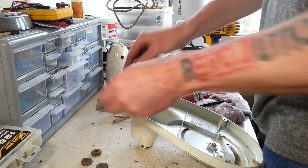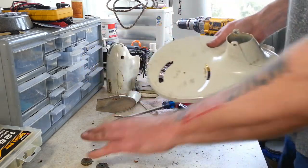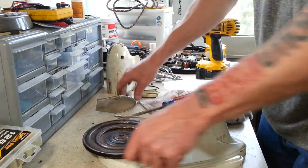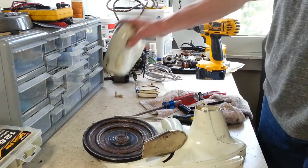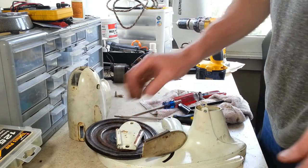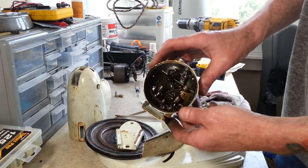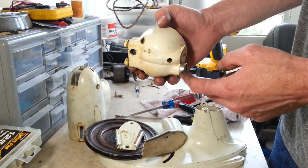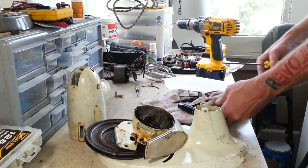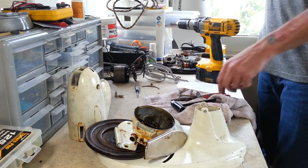All right, so here we go. We have five old brittle feet off. Now this is ready for sandblasting as well. All the parts we got here, some of them we still got to take a couple parts off, like the bushing in there, the stainless piece on here, and then on here we got to degrease the crap out of that and heat this up, take that off. Other than that, these pieces here are all ready, as soon as they're degreased and everything, for the sandblaster and ready for powder coat.